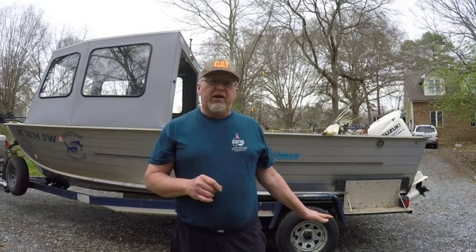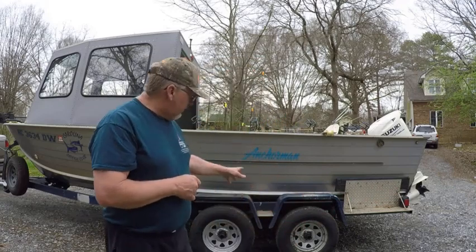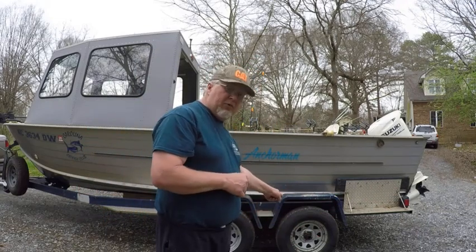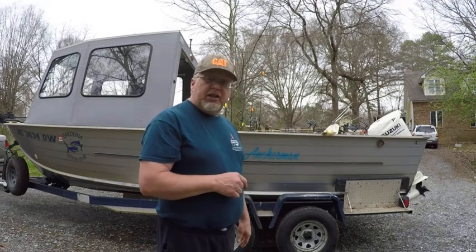Other thing, I'll go around and make sure all the tires are aired up. Make sure I don't have a tire that looks slack. Now this one, you can see the rims are pretty dirty because the last time I filled the bearing buddies with grease, I kind of overfilled that one a little bit and it started weeping out the weep hole, and I just haven't cleaned it off.